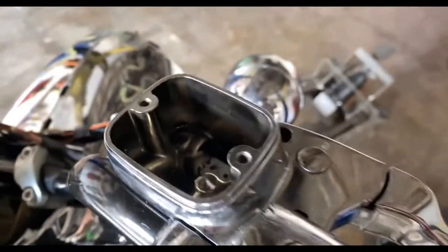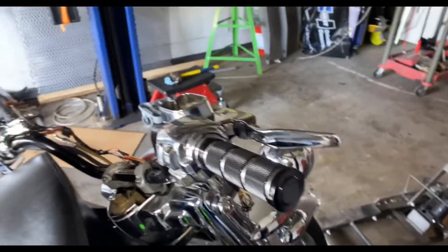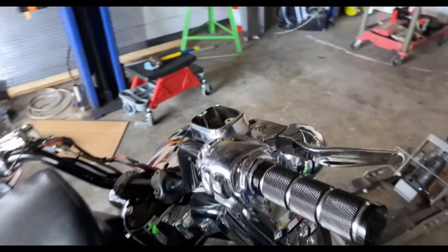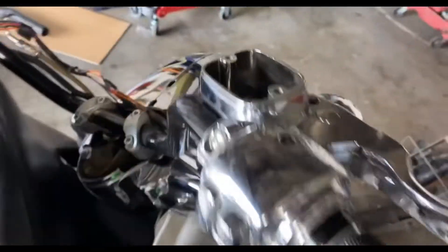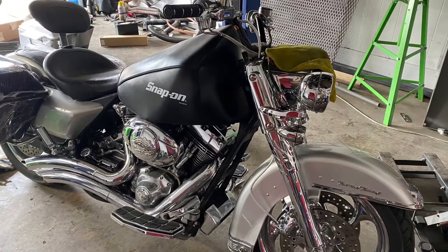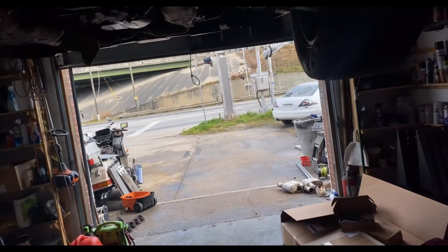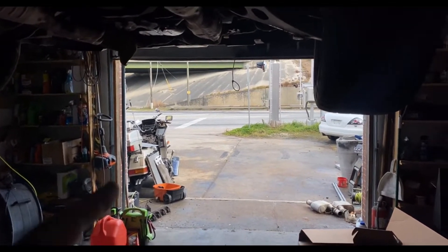Part of the fluid service — I'm taking out whatever brake fluid may have been in here. I don't know DOT 5 is factory, but actually I don't know what these controls came off of. The lid said DOT 5 on it. Either way, I'm doing away with DOT 5 because DOT 5 is a pain in the ass — I'm going to put DOT 4 in it, but I'm going to flush the system and clean it out so there's no mixing whatsoever. I'm going to do it with the clutch as well. We are in the mid-60s today in Savannah, this February, whatever day it may be — which means it's going to rain because it's super moist out.